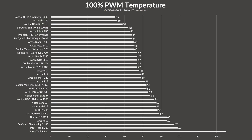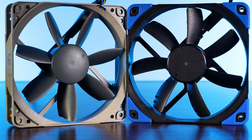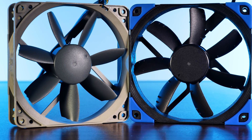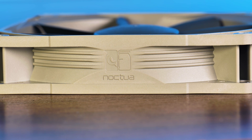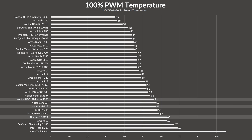Letting the fan spin at its max 1200 RPM, the NF-S12B managed to keep the 3700X at 56 degrees C. At first we were kind of shocked that the S12B was able to outperform its main lineup S12A counterpart, but it actually makes sense. Even though the S12A pushes slightly more air, the S12B can do it with a tiny bit higher static pressure, and as explained in our fan benchmarking video, up to a certain point our benchmarks favor higher static pressure. Something that didn't make as much sense is how they compared to the NF-P12 — they beat them at 100% speed. The best explanation is that the four CFM difference was more significant because the 1.3mm H2O advantage couldn't be effectively used due to the P500A's already very airflow-friendly front panel, or margin of error, or both.